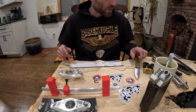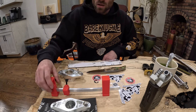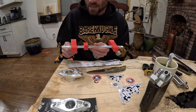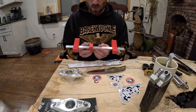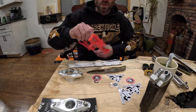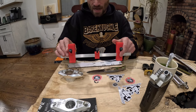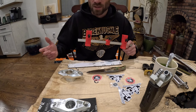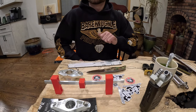As always, Bare Knuckle — highest quality American-made parts for your customs and Harley Davidsons. Also a shout out to last week's show and new Patreon supporter Nine Finger Fabrication. I didn't do him justice because it was the middle of the night when I was recording that intro. This is one of my favorite tools by him — his primary chain alignment tool. For guys wondering how you shim your primary chain properly, it's a mystery to some. A lot of guys don't even know how, and you will wind up wrecking everything from flywheel bearings in the engine to output shaft bearings on your transmission when that stuff's not aligned.